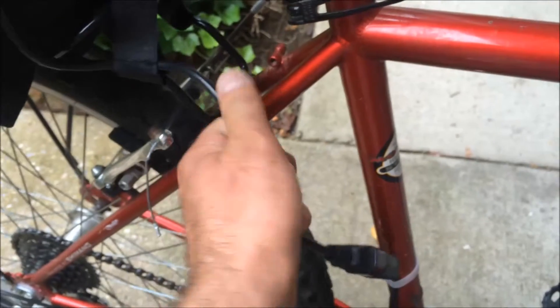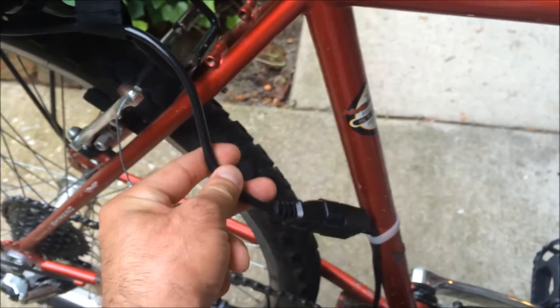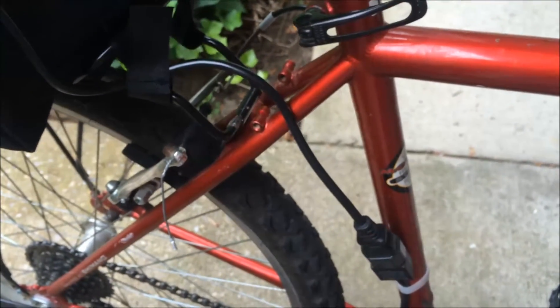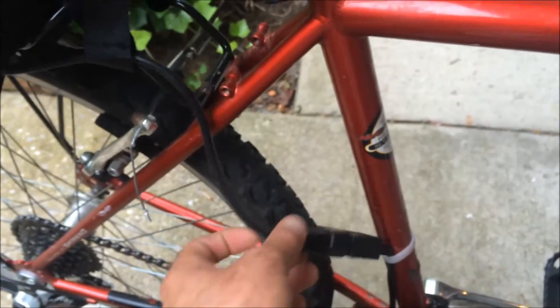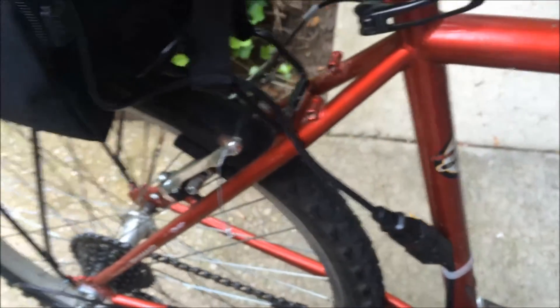All the way home, I tried using just battery power to get up the hills, and it did fine. The only thing is this power cord here is a little bit warm, and it's because it's not a large enough gauge wire for all the current going through it. So what I'm going to have to do is take some of my extra connectors and hook them up to larger gauge wire, and I've already planned out how I'm going to do this.